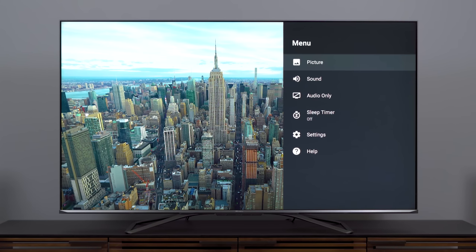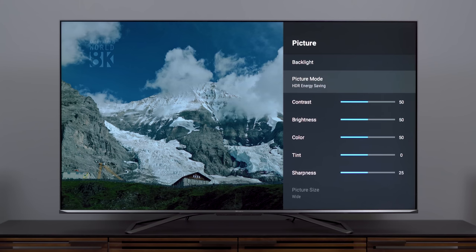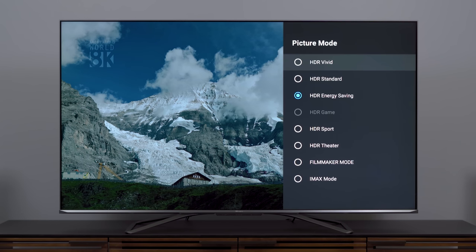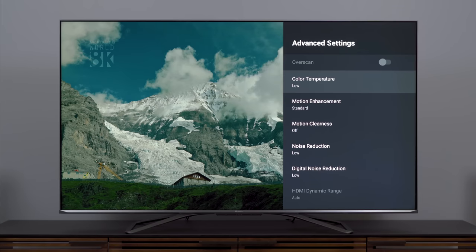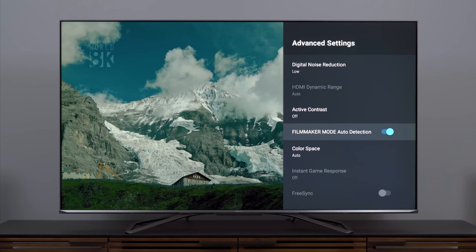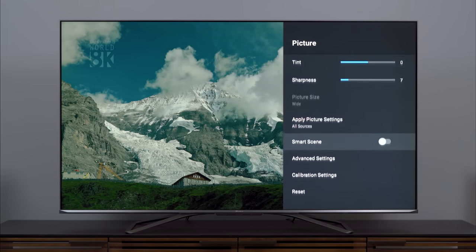I'm now in an HDR title. Pulling up the menu and going into picture, it looks like we're in HDR energy savings mode. While our SDR settings carried over to apps and HDMI sources, we still have to configure HDR and Dolby Vision separately. I want out of HDR energy saving and I'll select HDR theater, which is probably the most accurate — though I'm also curious to check out IMAX mode, that'll be a first for me. HDR theater selected, and immediately the color warms up. In advanced settings, color temperature is low and motion enhancement is turned off. Filmmaker mode auto detection also needs to be turned off for my testing, and those HDR picture settings should now apply to all sources.